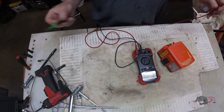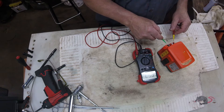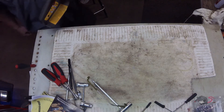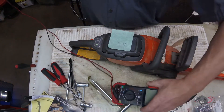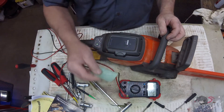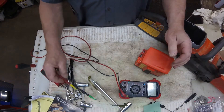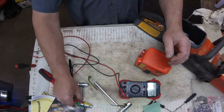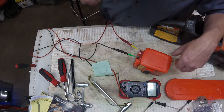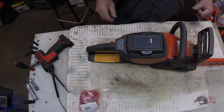Just for giggles, we're going to test the old battery and see if there's any juice in it at all — and there ain't much, it was about 6.7 volts. So it's tomorrow now. We pop the battery out and get a voltage reading. The accepted range is less than 0.3 to 0.5 volts of drain. We ended up at 40.2 volts — that's four tenths of a volt, which puts us in the range of: she's foobard.